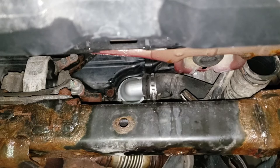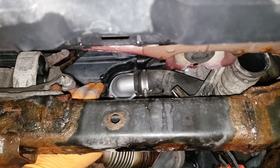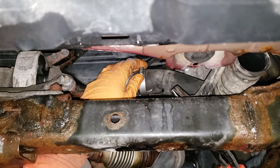Before you reinstall the thermostat with your brand new gasket, put a layer of silicone on the back of the gasket and then a layer of silicone on the cleaned aluminum piece. If you want to avoid cooling system issues altogether, change your coolant every 50,000 kilometers or every two to three years — don't let it go longer than that. With your thermostat housing installed, make sure you torque these bolts in steps: run them up by hand, torque to 6 ft-lbs, then alternate, then 8 ft-lbs, then finish at 10 ft-lbs — so the sequence is 6, 6, 8, 8, 10, 10. Make sure your new worm clamp is positioned so the adjustment section is accessible.